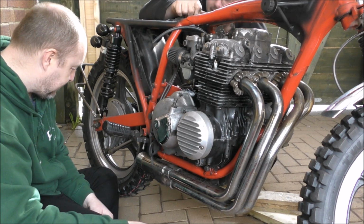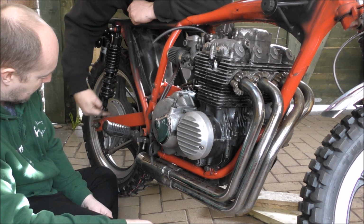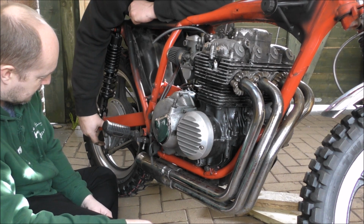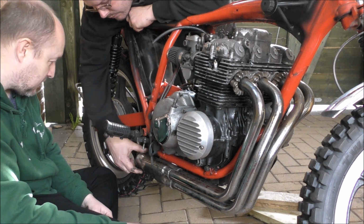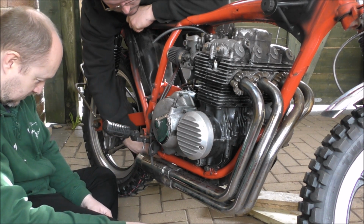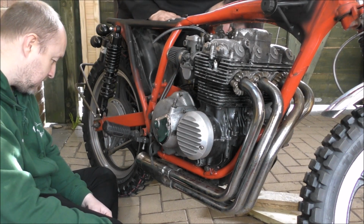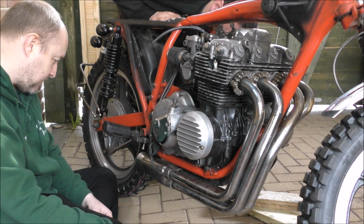And the reason I say that is because we don't have an exhaust hanger. No, we don't. So we can't have a big old pipe sticking out here. Good point. So if that happens, then we're going to have to put a little elbow on here. We'll maybe cut a bit more of a collector off, run it round and tuck it across. And we can bracket up underneath here, and then dump out this side, on an angle, downwards.